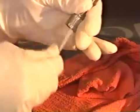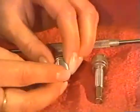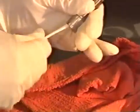The Tri-Glass injector system is made from high-quality stainless steel rather than plastic or disposable parts. Keep your injector clean. Dirty injectors will contaminate the resin and cause the repair to break down over a period of time. Once the injector base and press are completely clean and dry, store them in a small, clean plastic bag until your next repair job. Just before you start your next repair, reapply the O-rings to the injector base and press. In between repairs during the same day, you can wipe the injector base with cotton swabs and wipe the injector press with a clean, dry, lint-free cloth.